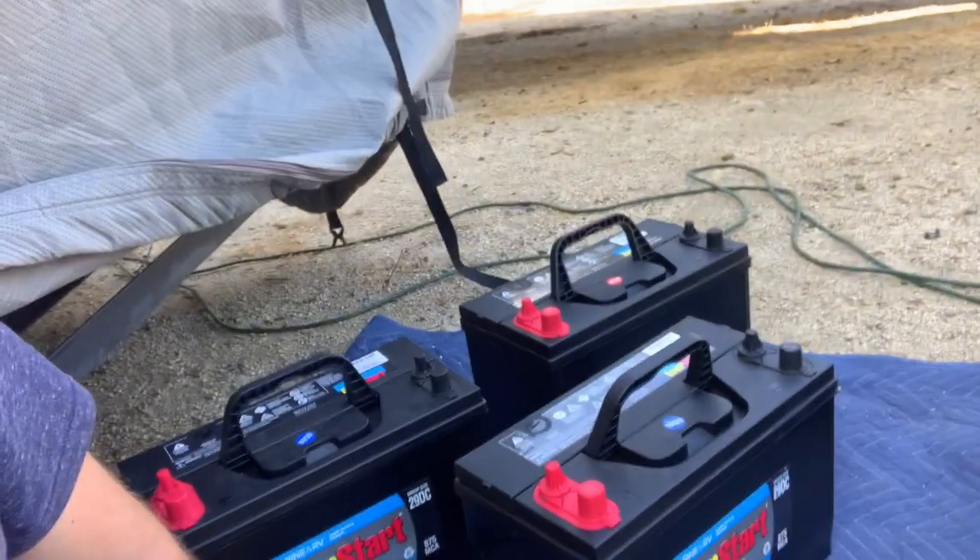Battery-wise, I've relocated my batteries from the front of the toy hauler — right on the A-frame — to the very back. I did that first because I wanted to run more batteries. We're running three Group 29 size batteries at 875 cranking amps, which gives a really large capacity. We also have solar on the roof, so between solar and batteries we'll hardly ever have to use the generator, unless we need to run the microwave or the outlets. We also have an inverter inside for the TV.